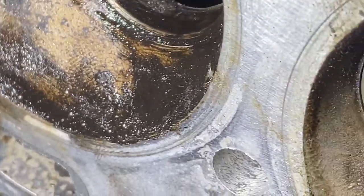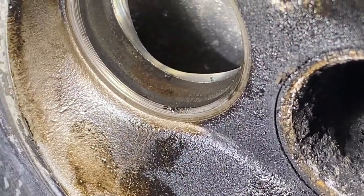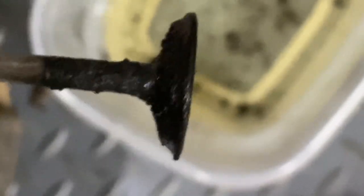And one of the other valves broke. The valve lash must have been, you know, an inch. That's crazy. So, there's the seat. Our exhaust valves are just dirty, but they still have that top hat kind of shape almost. But I'll definitely get another intake valve, that's for sure. So we can't put this engine back together totally, not yet.